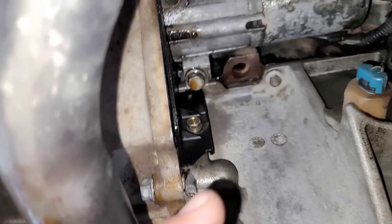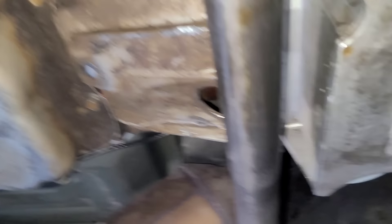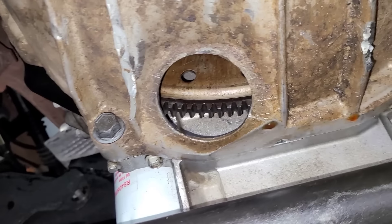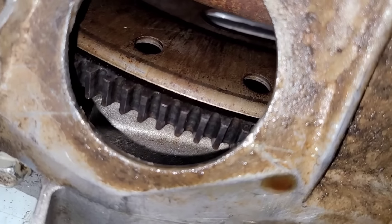All right. So here, as you see from underneath, that oil is dripping there. If you look up towards the starter, there's oil all up in there. It's hanging off the sway bar here. There's a little tin cover that goes there in the bell housing — I pulled it off to look up inside, but I don't see anything of consequence up in there.